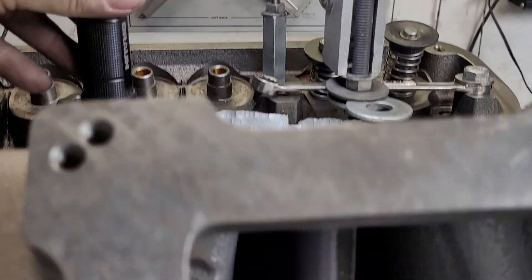So what can we say about this? I'd like to do better than that, I'll be honest. Take a look at the swirl curve. I don't remember this head having nearly as much swirl as when the tunnel ram is on it — I think Eric said that. He remembered the tunnel ram kicking up the swirl.